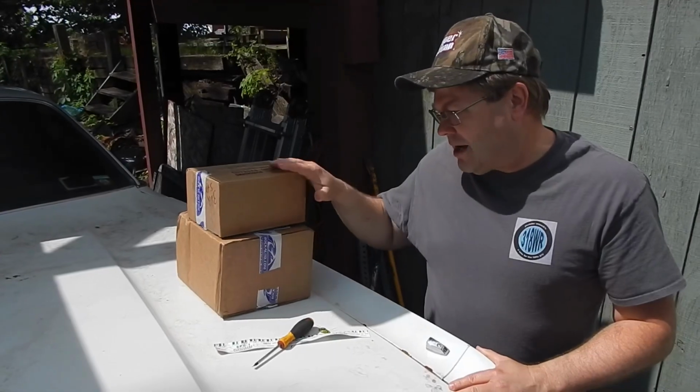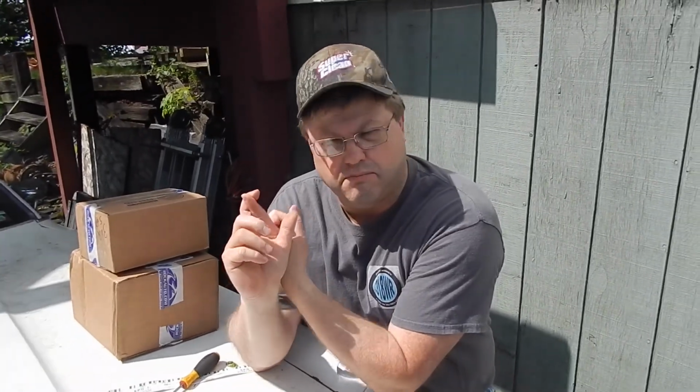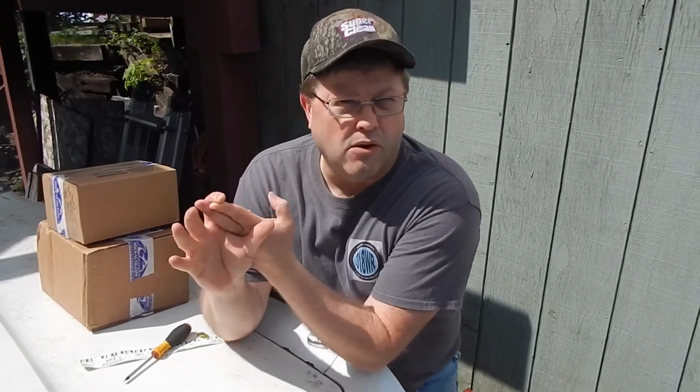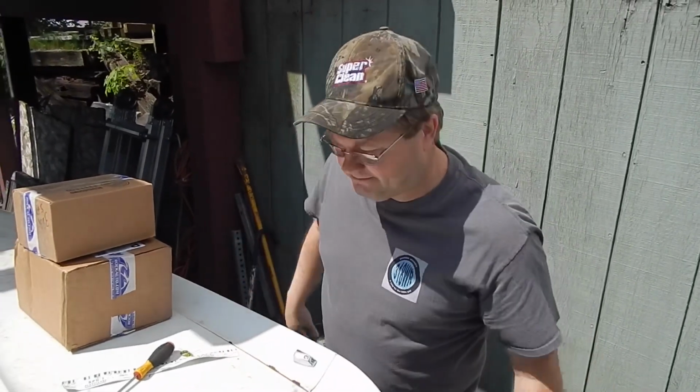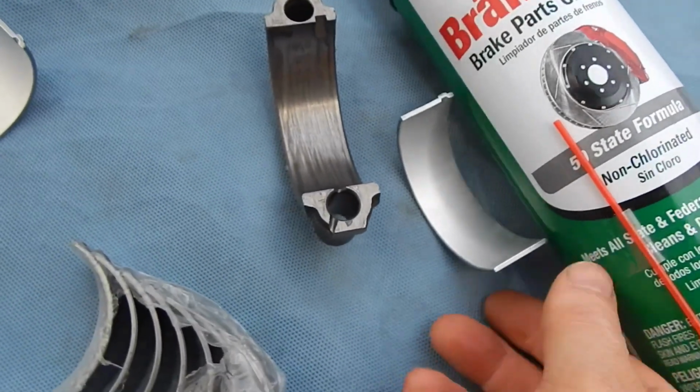We're going to try just the rod and main bearings, just because I didn't have bluing on the one rod where you would normally think you need to resize the rod or replace the rod. And two, the crank looked absolutely phenomenal. But three is, when it had oil pressure, it was quiet and ran good and had oil pressure. This is what we're going to try. Either it works or it won't, guys. Probably won't. So this is what we're going to deal with.